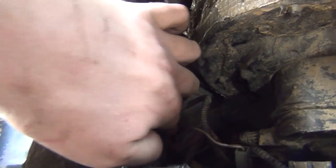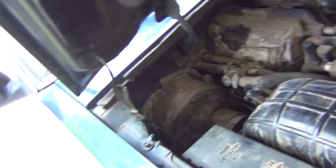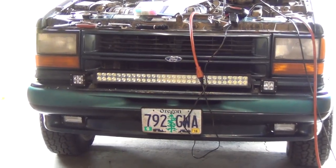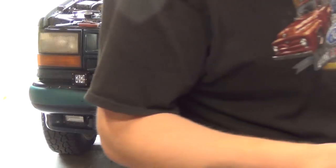This is my main harness here for lights coming up from the back, and then the lights for the front. Here are the two relays. I'm gonna try and get back here with a drill — I've got some self-tappers, I'm gonna screw them into the inner fender right here so they won't rattle around or rub.